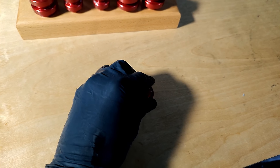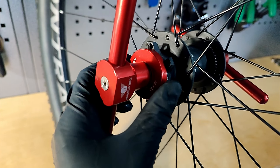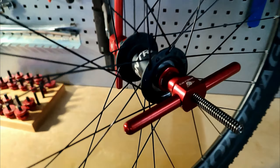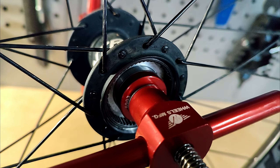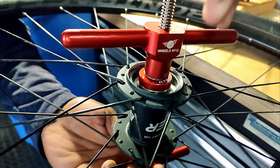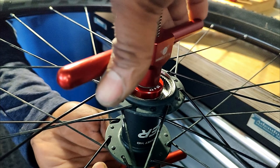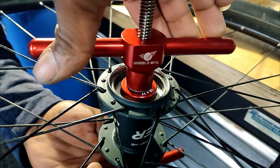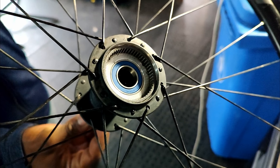I'm fitting a 3017 race into the bearing and putting it on the press. On the brake side I've fitted a 6806 spacer because it sits nicely in the gap, and on the other side I have the race, press, and bearing ready to go. I'm pressing the drive side first — I'll explain why. Slowly and methodically press it in, and when you feel a ramp up in torque that means it's seated in the bearing seat and you can back off.